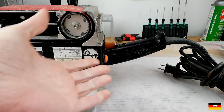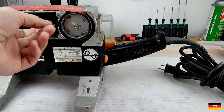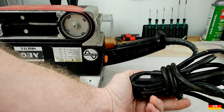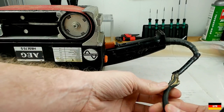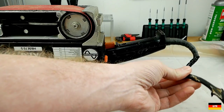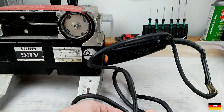What I like to do whenever I buy these power tools is go through them to make sure there's no problems that could develop in the future. I've always liked taking things apart, even if it's not necessary, just out of curiosity. The first thing I noticed is this cord — it's totally rotten. Looking at it, it seems like it's just the outer jacket that's damaged, probably from UV or possibly water breaking it down over time.